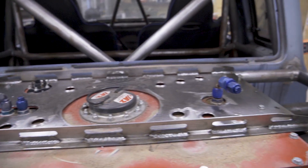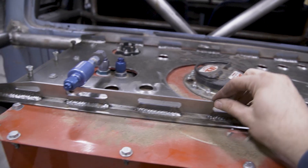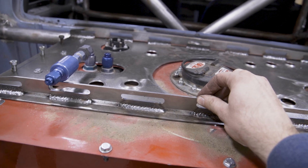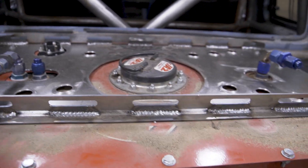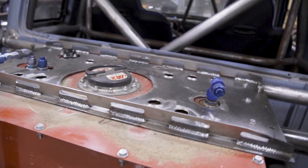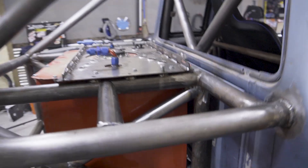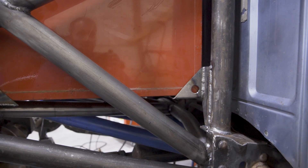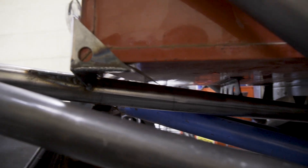Here it is, in and seated. Sits pretty dang nice. I need to get more hardware — I'm probably going to do some stainless Allen heads on those or something like that. I added these supports across it just to give it a lot of strength in case it rolls over, to help contain the fuel. It also actually acts as a nice little mounting location for my strap when I go to pull it in and out. Overall, I think it worked out pretty good. The main part is held up on top and I have my supports on the bottom just to locate it forward and aft and keep it from moving around.